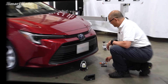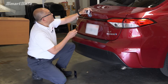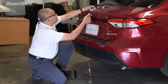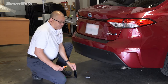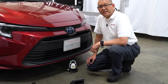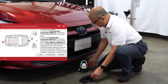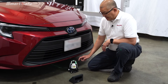We'll go ahead and move to the rear of the vehicle. Here at the rear we'll go ahead and determine our point B — find our center — and then we'll go ahead and place our laser reflector at the rear. Moving back to the front of the vehicle we'll turn on our five-line laser and shoot that back towards the rear of the vehicle. We'll use our auxiliary mirror here to make sure we're making the connection at point B. We'll use our fine tune adjustment, and there I can see the laser at the rear. Pressing the V button again gives us our center line.